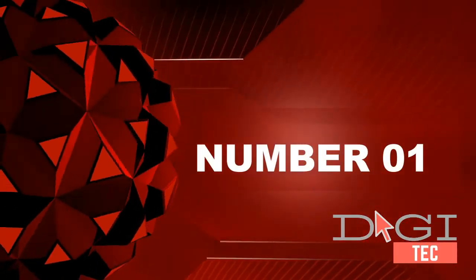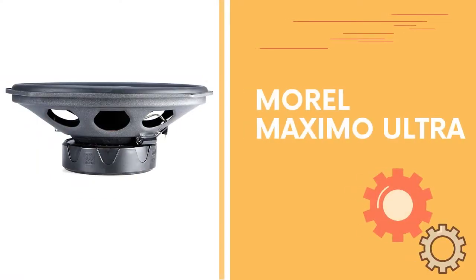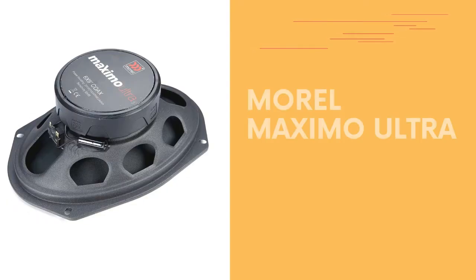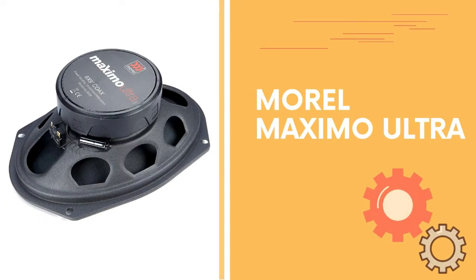Number 1. Morel Maximo Ultra Coax, 6 inches x 9 inches, 100 watts RMS. Maximo Ultra Series 2-way coaxial speakers. Sensitivity, 92 decibels at 2.83V. Treated paper composite woofer cone with butyl rubber surround. Soft textile dome, Morel Maximo Ultra.